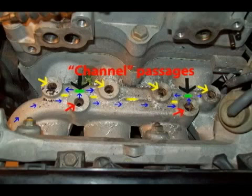You can buy new plugs at the Honda dealer for these ports, but I'm going to reuse the old ones and tap them and put anti-seize on them and plug them. That way, by having a removable screw, the next mechanic that has to do this job will have it just a little bit easier.